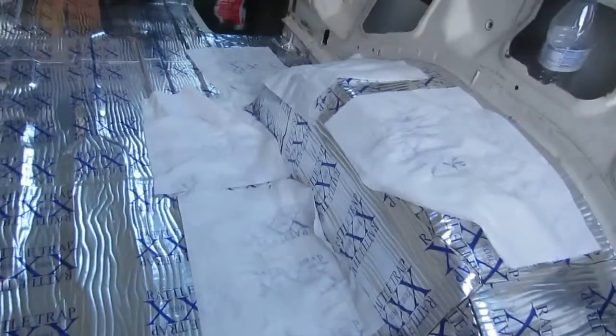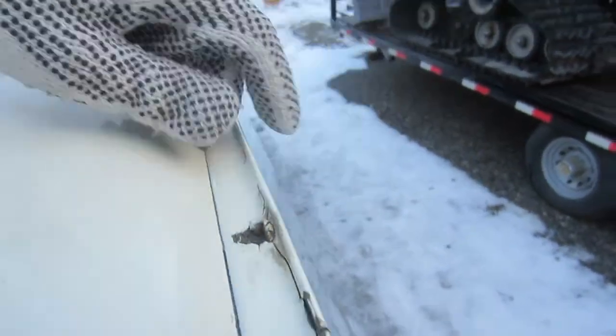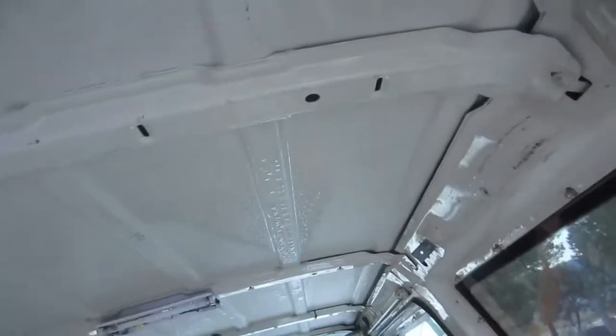I'm getting leaks in my van where those towels are — water accumulated up there, and there's a bunch of condensation. I think there's a gutter-like ridge here that's been collecting water from all the snow that melted. You can see a puddle here, and over there was a puddle I just wiped up. Water is getting into these gaps, which are rusted in some places — pretty deep grooves — making it inside, dripping down, then evaporating and condensing up on the ceiling.